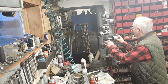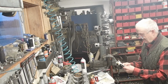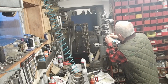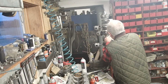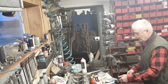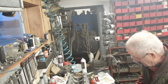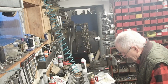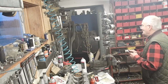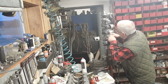Okay, now the last thing I'm going to do here is put on a center main bearing. Again, we make a line of grease, needle bearing assembly lubricant, not 2,4-C. I did already replace the bottom bearing, which I do in these things. I used to always, because the bottom bearings would go before anything else. They're a single row. The top bearing is a double row and doesn't seem to have the same problem. When you took them apart, ones with 2,000 and 3,000 hours on them, the bottom bearing would always be pretty loose. And it would wobble and wipe out the seals.